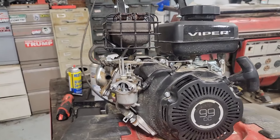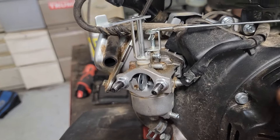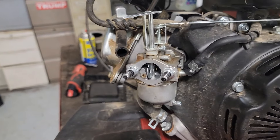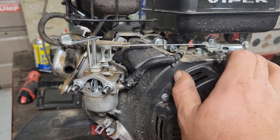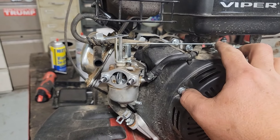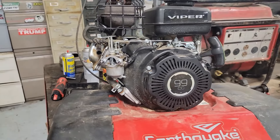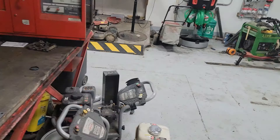I've got the carburetor back on - I'll just tighten these nuts hand tight and put the intake on in a few minutes. All I did was drill that out, that's it. It revved a little bit, it surged a little bit when it first started because I don't think the carburetor was full yet. Other than that the thing runs like a top - and it's that stupid little starter jet.